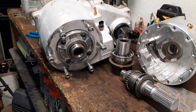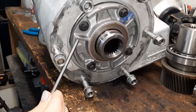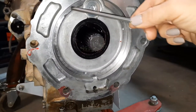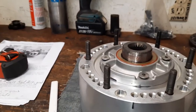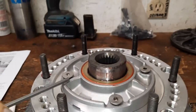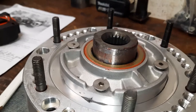We're getting ready to take the transfer case apart to put the new input shaft in it, but I wanted to point something out that we ran into trying to get the echo box on the transmission. See those little spots there? They've been self-clearancing. If you look over here at the transmission, those spots were hitting on the bearing retainer right there.